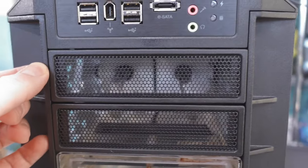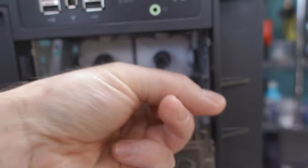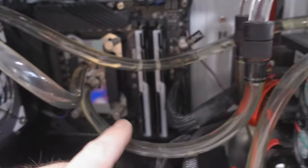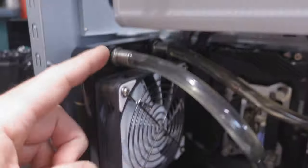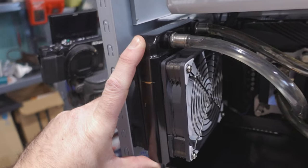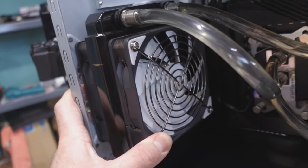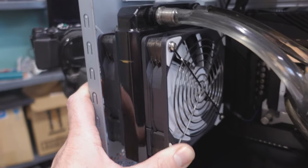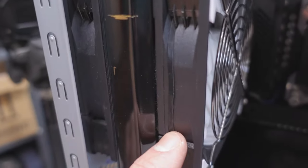And in the front, quite picturesque-like, but not quite picturesque, it's picturesque when it's fired up because of the RGB mods. It comes in, loops around, goes through the rad, loops around back out, and then boom, bud, it goes over to the CPU, a Heatkiller 4. Again, those same fittings. Then it goes out to the Hardware Labs GTS. That's the first water cooling rad I ever got, Gen 2. And that's essentially my CPU rad. Two fans, push, pull. Those are Deepcool Gamer Storm fans. Really good fans for the price. And I have modified this one with RGB. You can see scraps of what used to be IDE cable there, linking the four together. And then, you know, out from there into the reservoir.